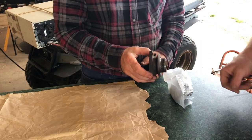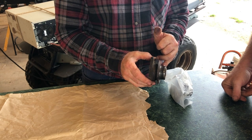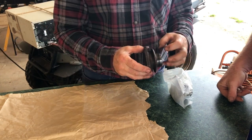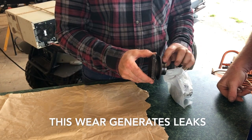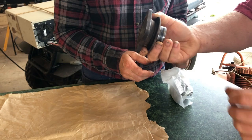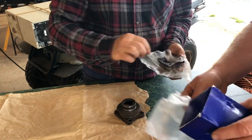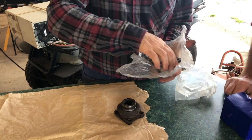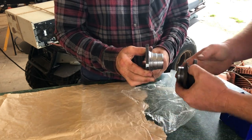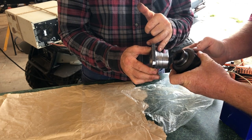That's the output flange from the pinion on the differential, and it's got a worn divot. So that's at the rear of the diff to the prop shaft — the prop shaft connects here, and there's an oil seal that seals on it here, but it's not going to seal properly with that divot. You can feel it when you run your finger over it. We ordered some new ones — nice and smooth where the seal goes, quite a comparison. We just have to take this pressed metal mud slinger flange off the old one and put it on the new one.